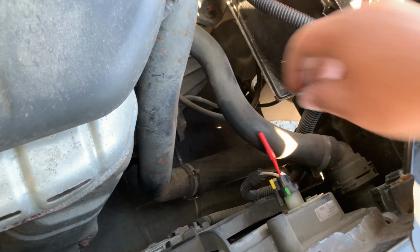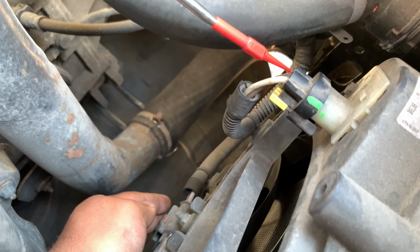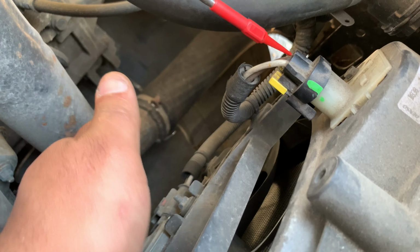Right, so this is the other side of the resistor, which feeds the motor basically. And speed 1 and 2, this brown wire is basically spliced up together. I'm going to perform again. See the relay clicking, no light. I'm going to measure the resistance now in this resistor. Guys, there we go. So I've got the meter on resistance there, probing the 2 pins on the resistor, and we've got open circuit. And there is a nasty burn here as well.